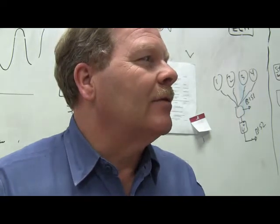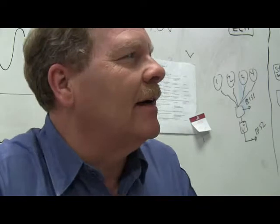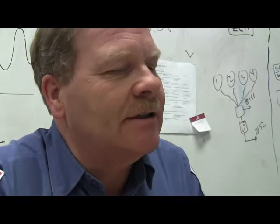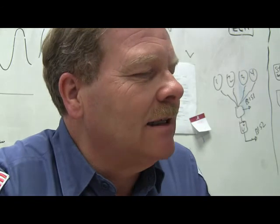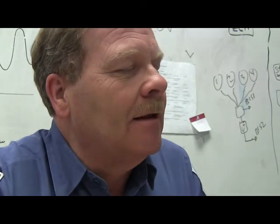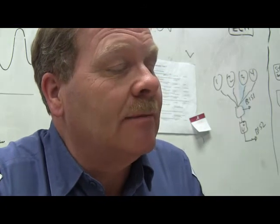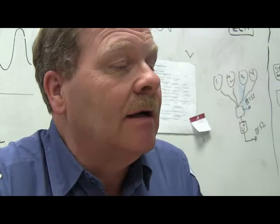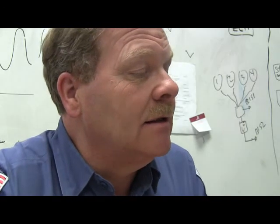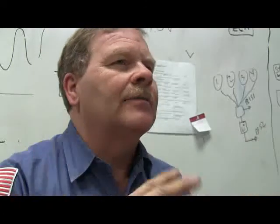Okay, now this is something you really had no way of knowing. This clutch disc is 6 inches in diameter and has 8 torsion springs to dampen vibration. That's actually false. The main shaft, input cluster gear shaft, and fifth gear shaft bearing preload is maintained by a selected shim behind each shaft's bearing cup in the transmission case. That is absolutely true. Remember I told you there were shims behind those cups to set that preload? That's how they do that.